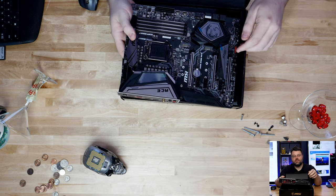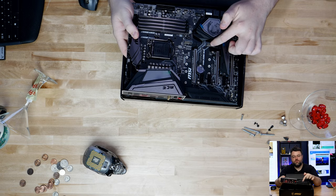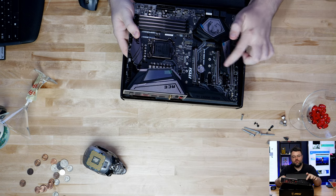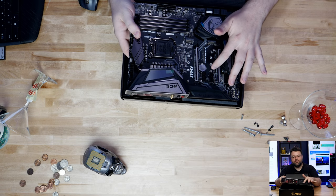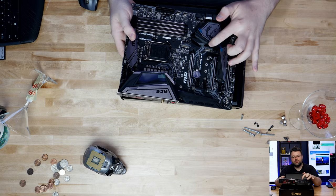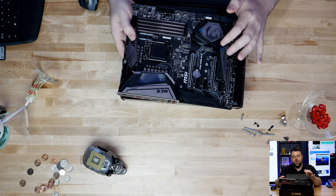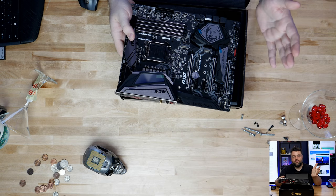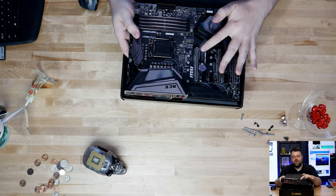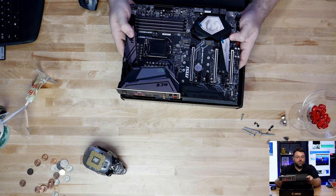You got 3 physical x16 slots, and then we've got a lot of PLX switches here, and also our M.2 here. We're going to have to check the manual and see what the breakdown is, because I'm noticing these other PCIe switches, and I'm wondering if the PCIe switches switch between slot and interface here, or if MSI has anticipated the DMI bottleneck and will allow us to run it x8 plus something. I'm not really sure, but we'll take a look at that.